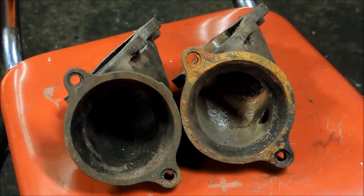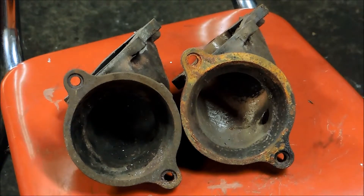We're looking at the swing valve right now. These look remarkably similar, but there is quite the difference. They're both a 2.5-inch swing valve, which a 2.5-inch downpipe mates up to perfectly. The 3-inch downpipe leaves a little to be desired if you've ever tried to run a 3-inch downpipe on a 2.5-inch swing valve. You know that doesn't quite fit well, and if there's a lot of engine movement, it really tears up the donut on the downpipe.